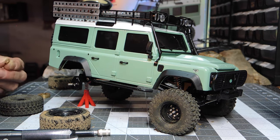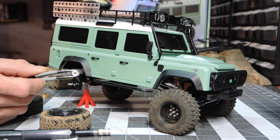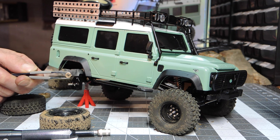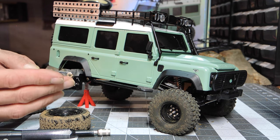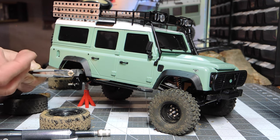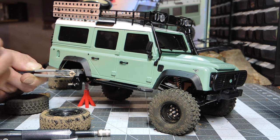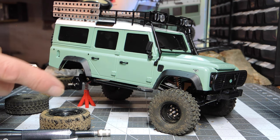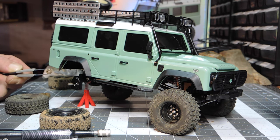All right, here we are for the fourth and final tire. So if you've been following along up to this point, yes, you know that all you need to do is basically take one of these standard 7mm hex, and you're going to want to grind off the 2 protruding pieces that you see that will offset on an SCX24. Basically, those are like bearing contact pieces of metal that keep the proper distance away so you don't bind on those particular axles.